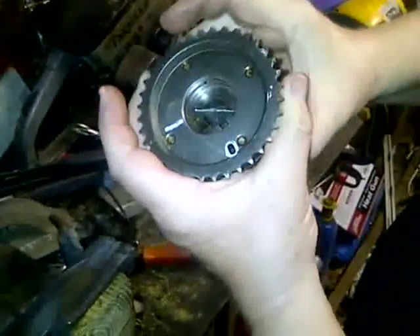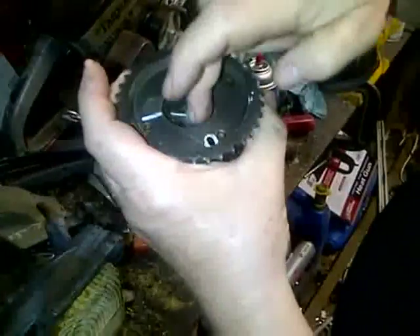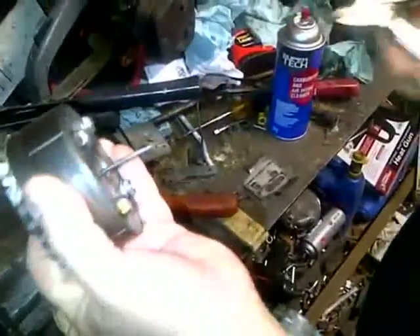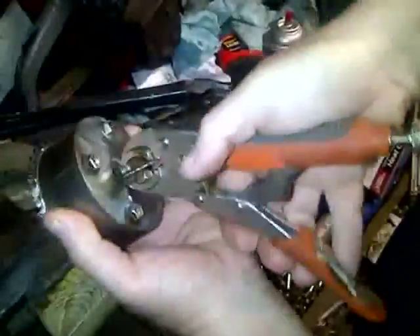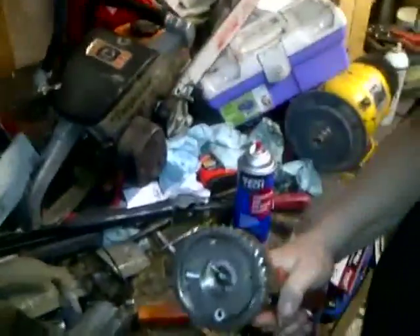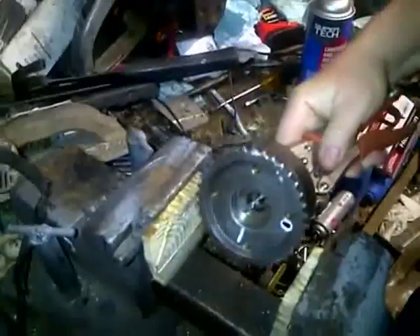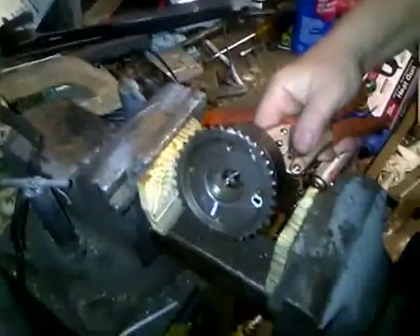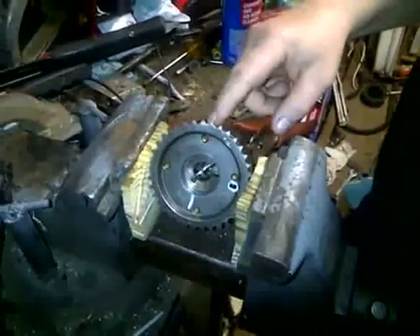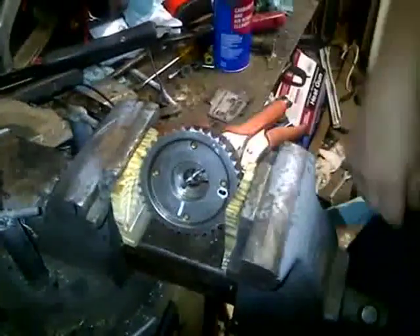In order to turn this, you have to put something on the back of it. What I do is hold this with my finger here, and I take vice grips and put them in here, getting them as close to the gear as you can, close to the face, so that it won't pull out. Now we're going to put this in the vise with the hole down and on a little bit of an angle so you can see what you're doing. Clamp it in the vise. This one's broke, but fortunately my nephew bought another head and it had the cams and timing gear, and I unlocked that one and put it on the car.